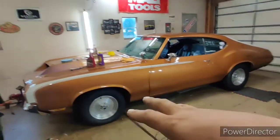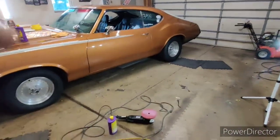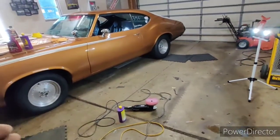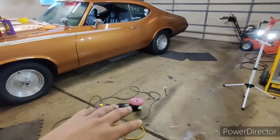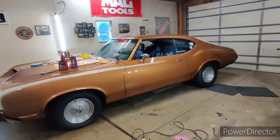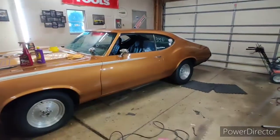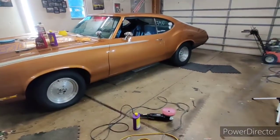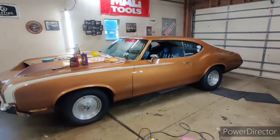The front fender polished for the last step. So what I did was, I'm not really familiar with this buffer. It is a high-speed buffer — spins out of my comfort zone. I'm used to regular buffers with a single motion. This is a dual-action high-speed buffer. Usually for a cutting compound you're between 1,200 to 1,400, and if you're polishing you're between 1,100 to 1,000 RPM. This thing kicks ass. I love it. It's my friend who I just lovingly call Batman.